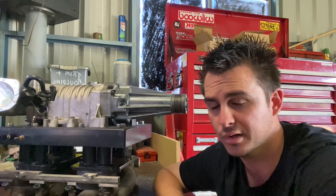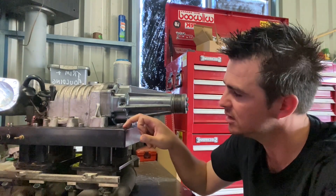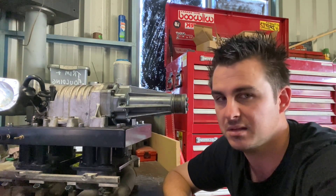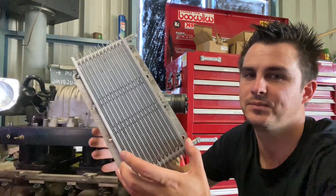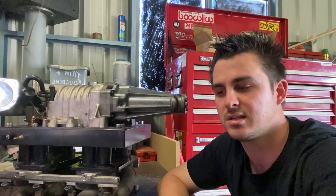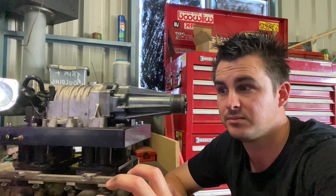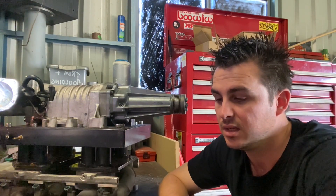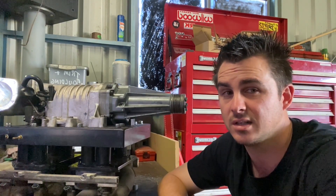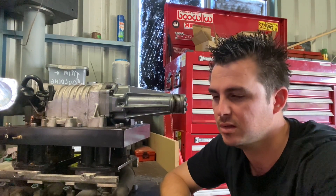The next step was water-to-air intercooling. If you're following me on Facebook or Instagram you probably saw I was playing around with a water-to-air intercooler setup to fit inside this manifold — mounted to the bottom side of that mild steel plate. I wasn't happy with how it turned out. It's a Davies Craig transmission cooler, 19mm thick — basically replicating what Mace call their Mini Blizzard kit. It would probably work fine on lower boost levels, but I'm running 10 psi with 120-degree intake temps, and clearance with the fittings just wasn't working. Decided to abandon that idea.